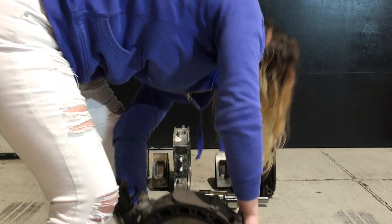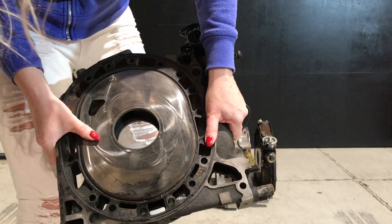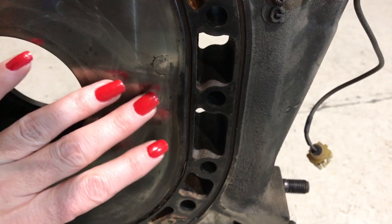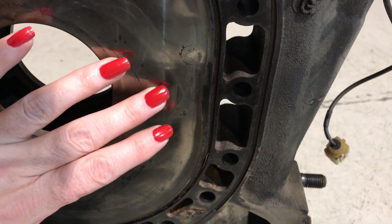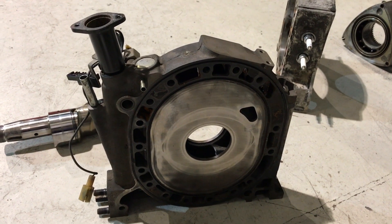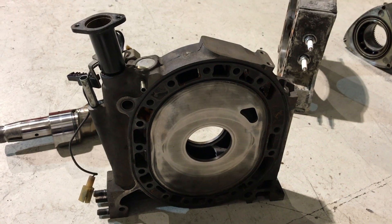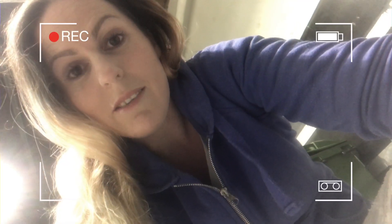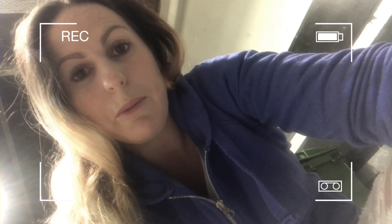The centre plate, while it doesn't look like it's in bad condition, the overlap sections have quite a noticeable ridge, and that is on both sides. That may be able to be reconditioned, or we may be best to just go with new parts. It's kind of depressing but project car life — this is what we do. Get disappointed, spend more money.